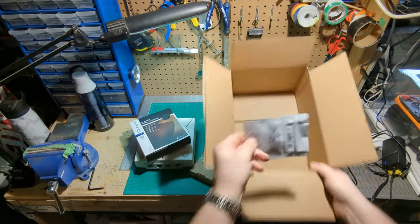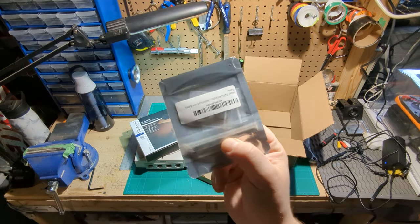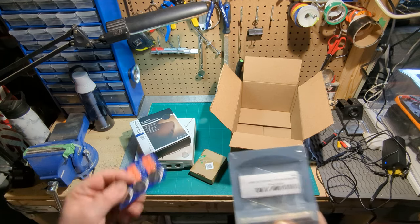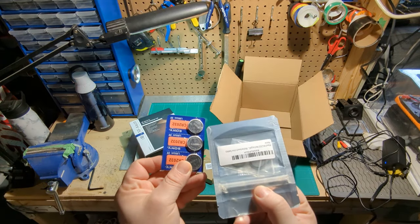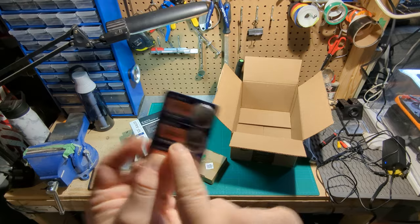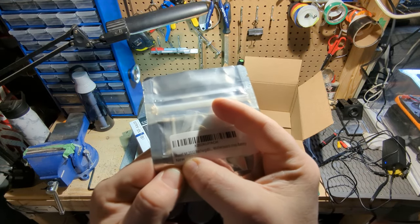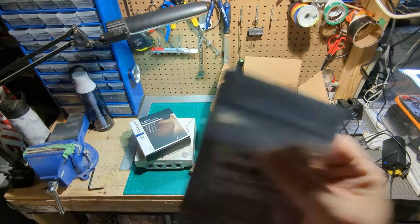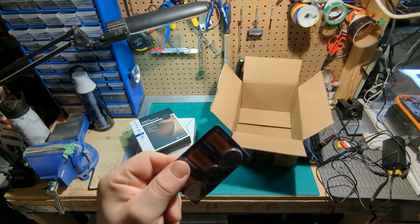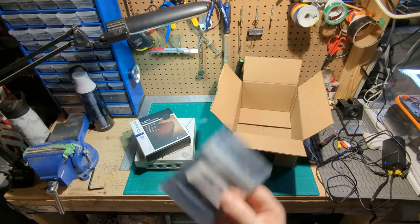As well as these little batteries. These kind of look like your standard wafer cell batteries that I tend to keep around in the millions. But these are CR-2032 style, while these are ML-2032 — meaning these boys are rechargeable. You're not supposed to put non-rechargeable ones in as a replacement, because it would probably explode and leak battery acid everywhere. That's a very good reason to use these instead.